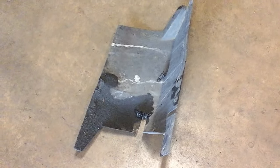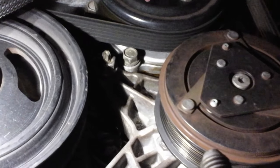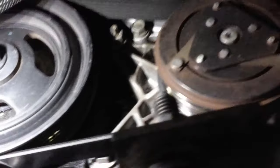You don't even have to take the wheel off. There's a shield in here with three body plugs. All you're going to do — there's the AC compressor, there's that bolt and that one there — loosen them, do not take them out, only take them back maybe two turns. That's it, do not take them out. You don't have to mess with the belt, nothing. You are now completely done here at the front. That's why I say don't even bother taking the wheel off.